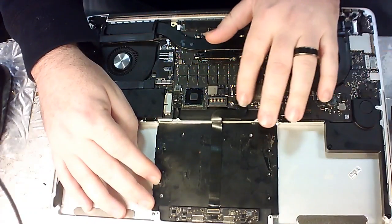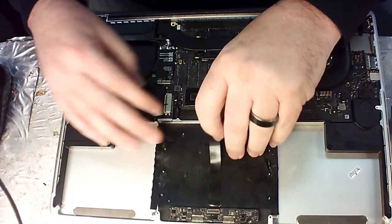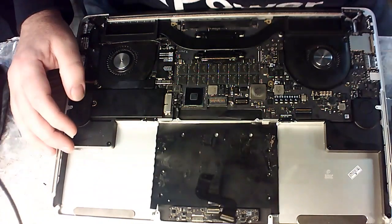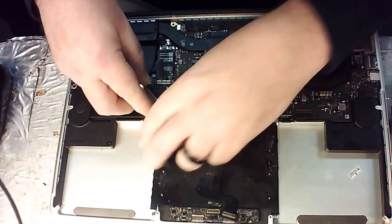You're going to find that there's a metal plate that normally goes right here. You have to unscrew that and remove this ribbon on here first. Take this ribbon off of there and use yourself a pry tool. You're going to work this ribbon, open this cover off of here carefully.